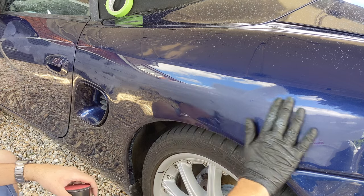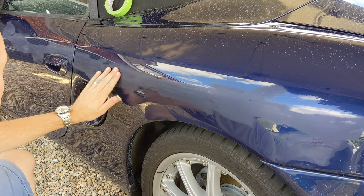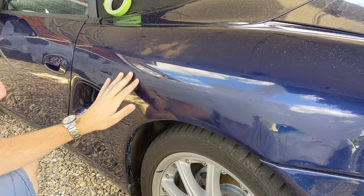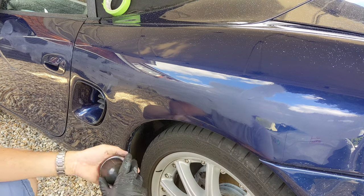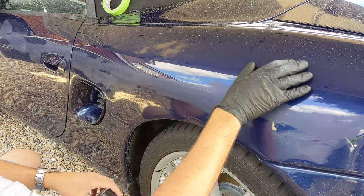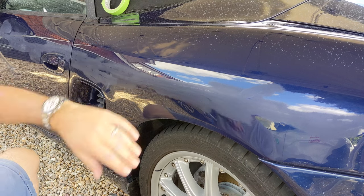Right, so all the major sanding's been done now, and I'm taking it back as far as I want to. It's still below the surface in places, but this is just an opportunity to make it look better than it was, not perfect. What I do need to do, though, is blend out the 2,000-2,500 sanding with a bit of 3,000 into this area around here. Be careful, because this clearly had some paint on at some point. Anyway, I'm just going to go around and do it on both sides.